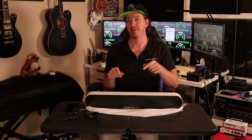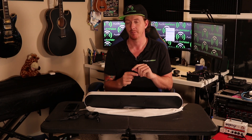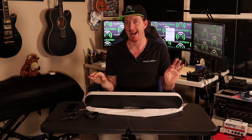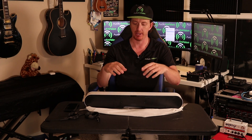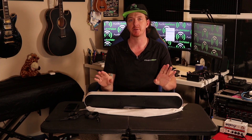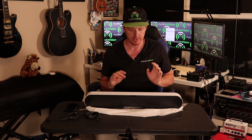You can also integrate third-party speakers using a Sonos Amp. The Sonos Amp has two powered outputs you can connect to any 4–8 ohm speaker. Used in conjunction with the Beam, you could use in-ceiling speakers, in-wall speakers, or bookshelf speakers as your surrounds.